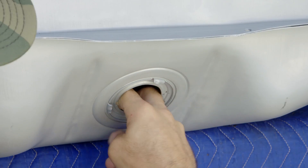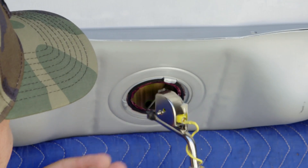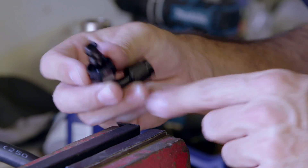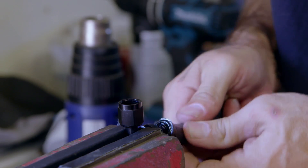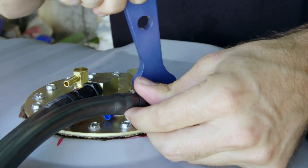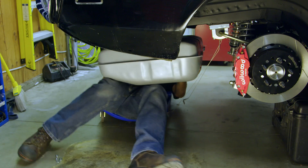First off, you've got to remember to get your flashlight back out of there — I almost forgot and left this in there. Making sure the O-ring is in position, just fit the sending unit into place and snug the capture ring. And that's it. Here's a quick shop tip on how to assemble twist lock hose end fittings: I put several pieces of tape on my vise jaws and use it to hold the fitting, then heat the tubing, apply a little Marvel Mystery Oil to both ends, and vigorously push it on until it bottoms out against the skirt. This is what the plumbing on top of the fuel tank will look like when it's installed — I still have to wire the fuel pump, but I'll get to that later.